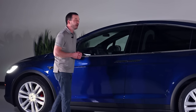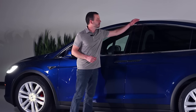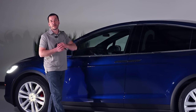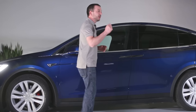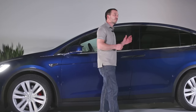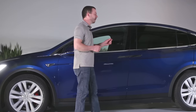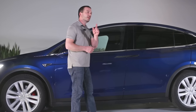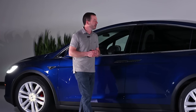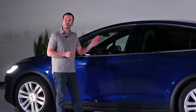We also have boron steel in the roof rail. That steel runs from just behind the B pillar down the A pillar, about halfway down the window. If we're going to be using hydraulic rescue tools to do a total sidewall removal or roof removal, we want to be aware of this steel. If we have trouble overcoming it with our power rescue tools, we want to use workaround techniques. Later, Assistant Chief Wells will show you proper workaround techniques that we developed for the Tesla Model X.